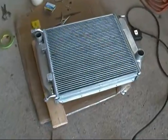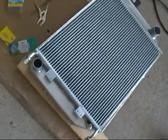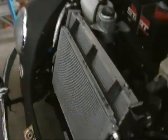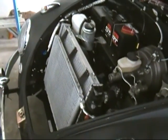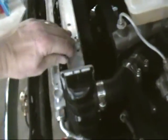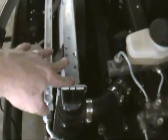I've been out here working like a madman on this new radiator I got. It's a big thick radiator with a new condenser to replace this radiator. This radiator is not quite cutting it — cools it down for a while but after about 10 miles of driving it starts to overheat a little bit. I've got this fan bolted directly to the radiator and a lot of open area here. This is a single core radiator with an automatic transmission cooler inside it, so I'm obviously not getting enough water flow to cool it down.